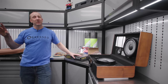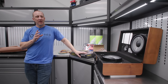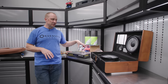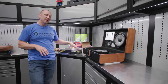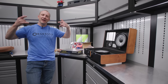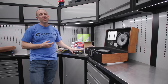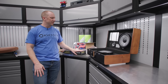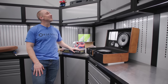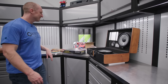We're going to use the factory subwoofer and the factory rear speakers, and disconnect the factory center channel. Matt has already done one of these exact systems in a Touring a couple of weeks ago, so he has a tune for me. When we get into the software, we're going to test polarity — the positive and negative — making sure they're not flipped. That's going to be the hard part. We're going to test each driver individually to make sure we don't have any signal cancellation.